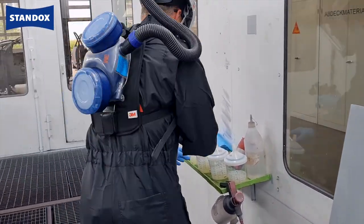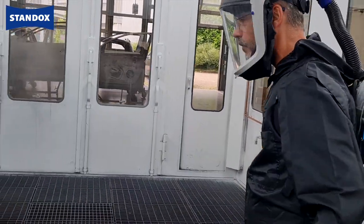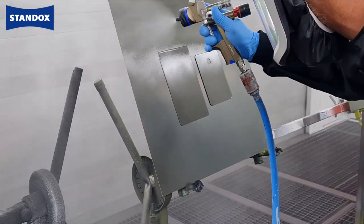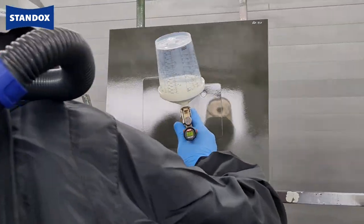Although the matte mixture is specific for the colour, there are other variables that can affect the final gloss levels such as OEM variation even on the same car, the age of the car, natural weathering and how the car has been maintained and cared for, and of course previous repair work.